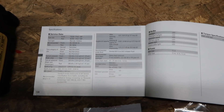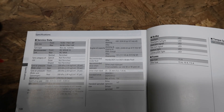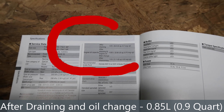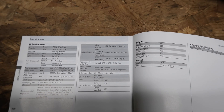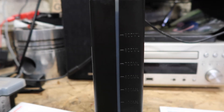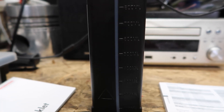How much oil should you be putting in? Conveniently, they tell you in the owner's manual. After draining and an engine oil filter change, it's 0.85 litres or 0.9 of a US quart. Conveniently, this Fuchs Silkolene stuff has a sight glass on, so you can tell when you've used 800ml because there'll only be 200ml left.